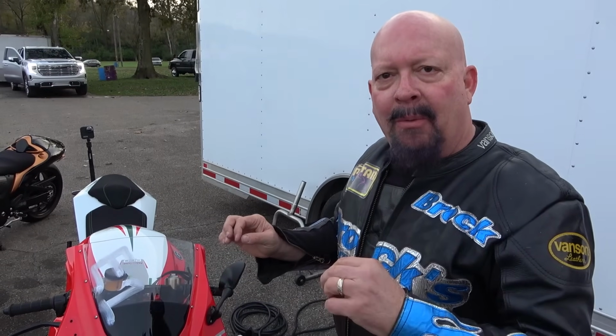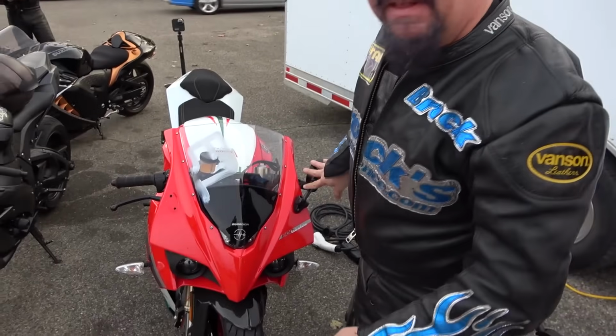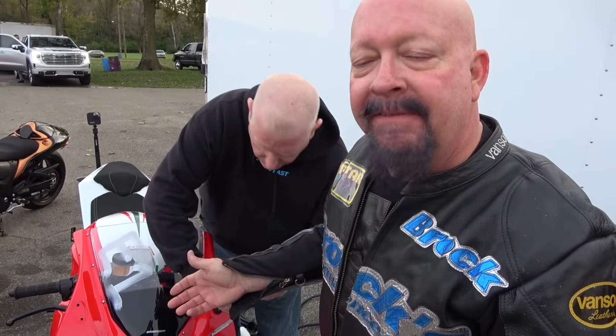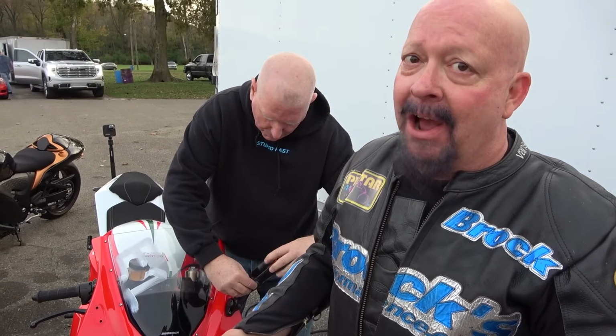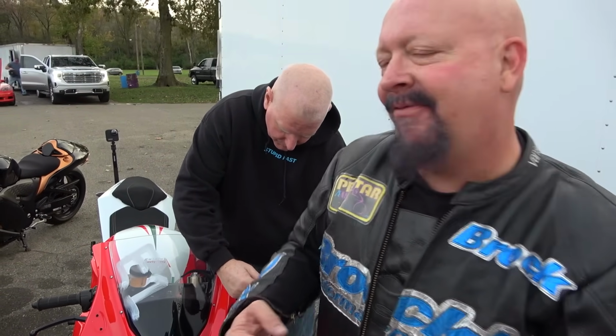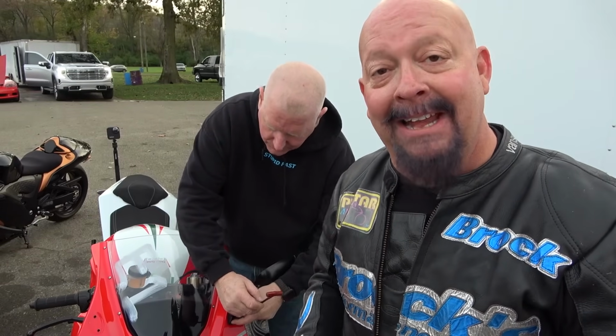All right, guys, so what have we learned? I made two passes, 60 foot, exactly 1.73 on both. So went a little bit quicker on the second pass, but that's because I ran more miles an hour. I had folded the mirrors back and picked up about 2 miles an hour, so we're just going to go ahead and take the mirrors completely off, since our tuning options are really slim right now, to try to get this thing to go a little quicker. Went a 10.50, that is definitely no slouch, but I'm a drag racer. I want to go 10.40 now, and we're going to do whatever we can to make that happen.